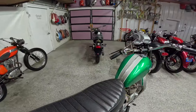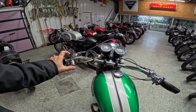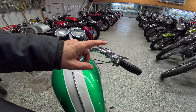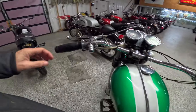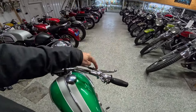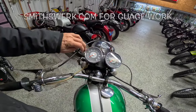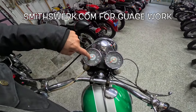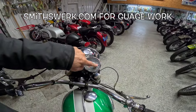Let's jump over here to the gauges and switch gear. Clutch on this side, of course. Horn — can you hear that? This is the high/low right here. Over here is choke and fuel. It's got those really neat barrel-shaped grips — I love the way those feel when you're riding. That's my favorite style of grip. Brake on this side. Looks like a fork lock right there. Ignition's over here. Smith gauges — isn't that cool? These are the magnetic type by now. A tachometer on this side with a mechanical tach drive going right to the back of the tach, and then the speedo on this side.